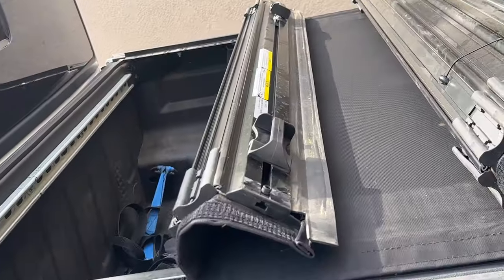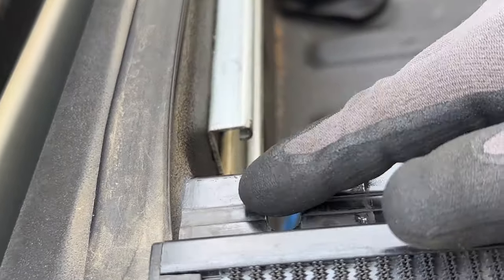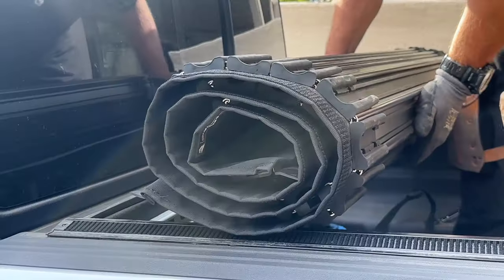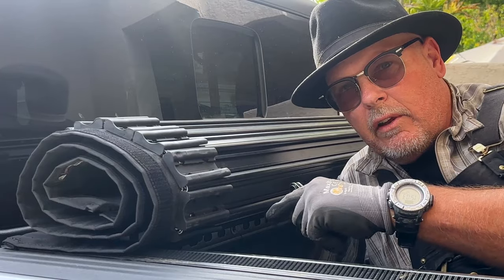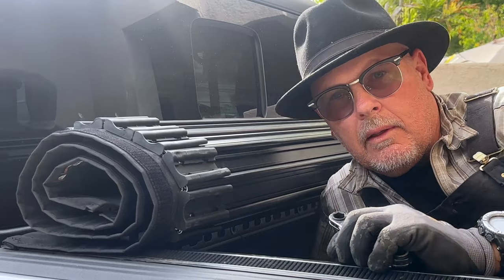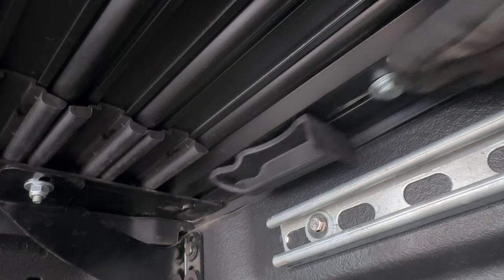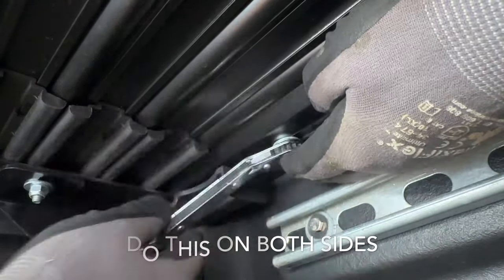Now you can just lift the whole cover right off. To reinstall the cover, make sure the small pin fits right into this small oval opening — that's going to hold the Truxedo exactly where you want it. Slide the Truxedo cover right back into place until the pins line up, then get under here and slide your clamps back into place and tighten your bolts. You don't want your Truxedo cover to end up as debris on the side of the highway. Just slide everything back into place, put a couple turns on the bolt, and it's locked back down.